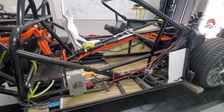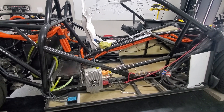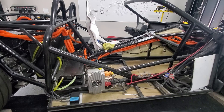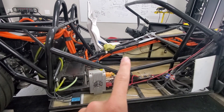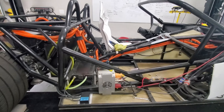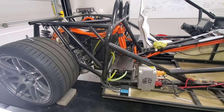Someone made a comment about the monitoring wires needing to be high voltage rated. While it's true they are technically high voltage, they're really low amperage - the monitoring wires all have very light fuses. Doing this again, I don't think I'd use orange high-voltage cables for those, because it makes the car look like it has a lot more dangerous high-voltage lines than it really does.